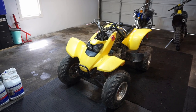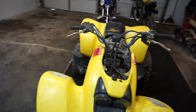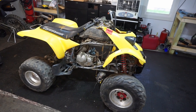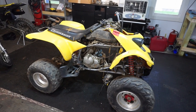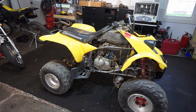Welcome back to a new video on the 2001 Honda 400EX. As you guys know, last video, a subscriber dropped this thing off, and he just picked it up. I think he got it for a pretty good price, but it would not run, and it had a really bad ticking sound. So we tore it down and found out that the cam chain was super loose, the valves were bent, it was not good.